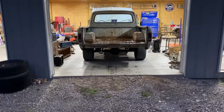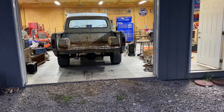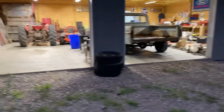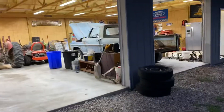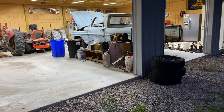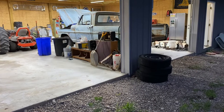I'm having a few issues here and kind of letting the truck warm up. My alternator's not seeming to want to charge. I didn't have a ground wire on there — I didn't know I had to — and I'm trying to see if it's going to start charging the battery. The battery's pretty low, but I noticed it keeps going up on my voltmeter.